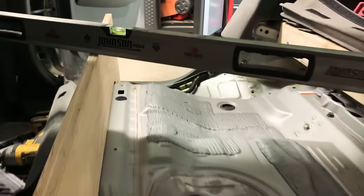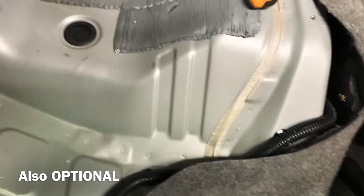Something I am a little concerned about is these tubings, so I'm also going to custom cut out these tubes here. Option one: bladed hole saw. Other option: jigsaw. Just leveling it here — it's just about perfectly level. My head will be a little higher, but I'm not too picky. Next, I took this blade and cut off this part of the carpet, because I'm going to line the entire inside and that carpet's just in the way. Drew some lines where we want to throw our brackets. We bolted in our brackets. So we have the top and we have the front. If you want to stop there, stop there — you can leave it just these two panels. Reinforce right where your brackets are, screw it in and you're good. That's the easy build. Throw your mattress on there. If you want to sand, prep, paint, and line all of your wood, check out my YouTube video on lining and painting.